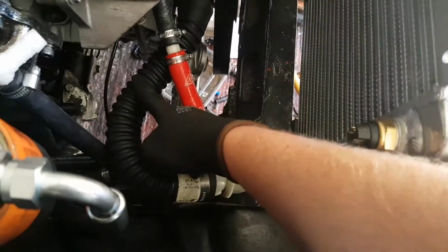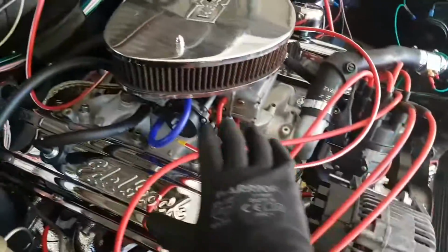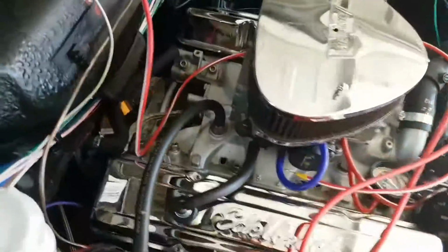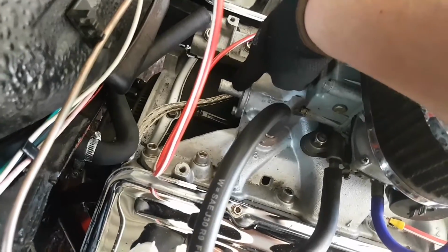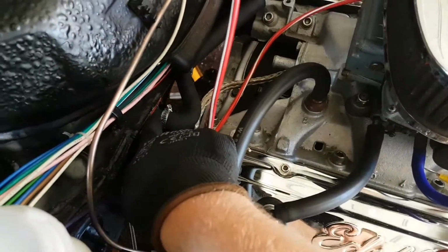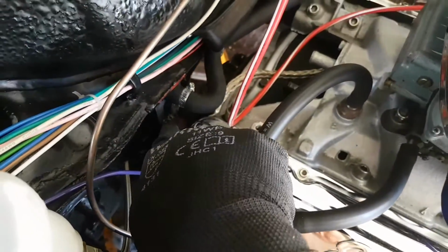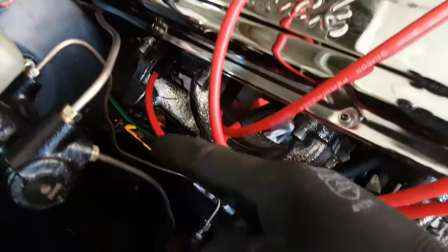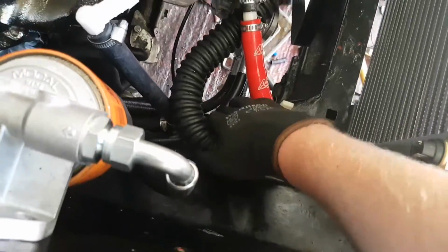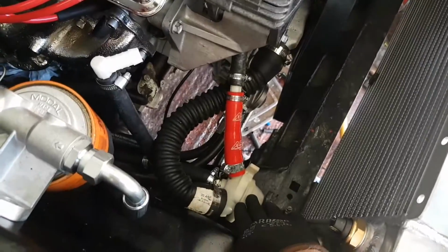The coolant's drawn this way, and it goes straight into the pump, and then through the heads, and it comes out of this back here, and it goes into here, which is the top of the heater matrix. Through the heater matrix, warms us up, comes back out of the heater matrix, and then runs around down here and back to here. So that's one full loop done already. So as the pump's going, this is closed off, and that's one circuit.